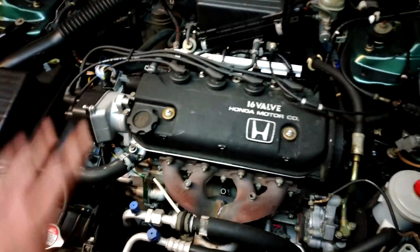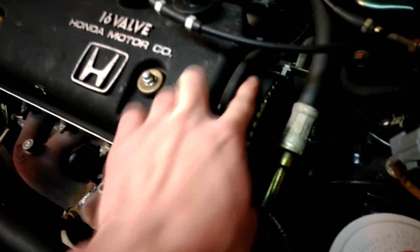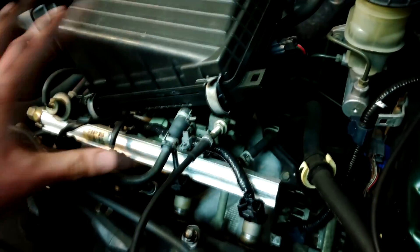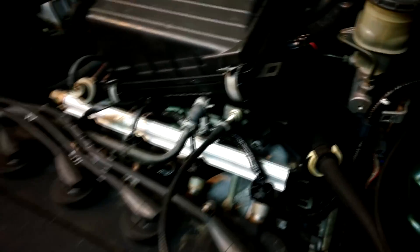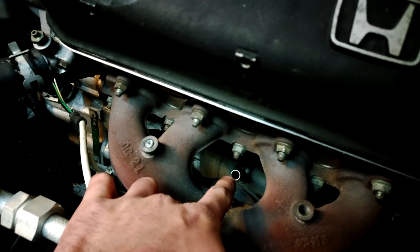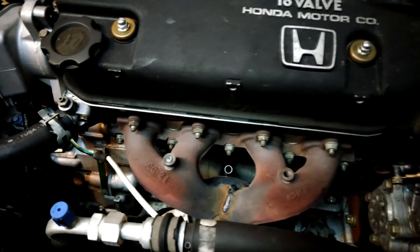To get this whole thing to work, it was essentially an OEM rebuild. Got the timing belt all put in like stock. I didn't put an intake manifold on in the last video because I was waiting for the D16Y7 manifold, because that's where the majority of the sensors are. Y7 exhaust — I cannot run a heat shield because the oil dipstick is right there and it has to come through the center of the manifold. On a D16Y7, it's somewhere down there on the oil pump. So no heat shield, got to leave it open for that oil dipstick.